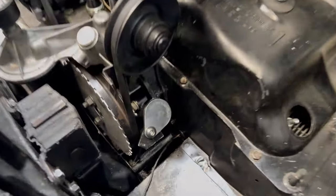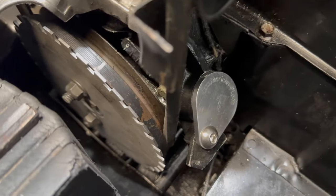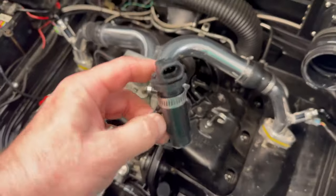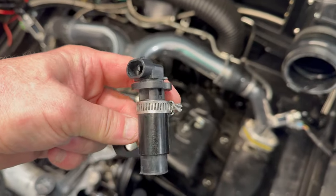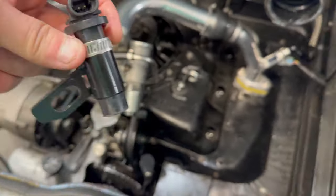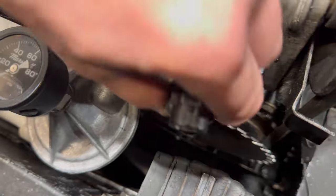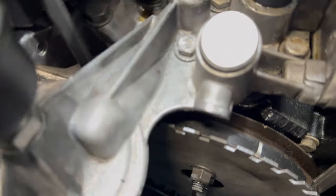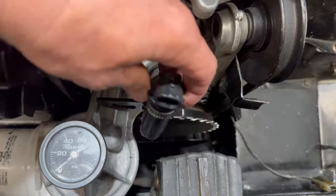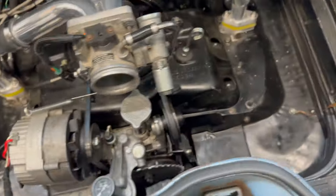With the distributor plug from American Pie in place, I've also got the crank wheel — the toothed wheel — in place, and it's sitting on top dead center. The next step is mounting the crank trigger itself. This bracket is also from Ted, and it's going to mount right on the bolt for the original fuel pump. There's a little bit of wiggle room to get it lined up just right.